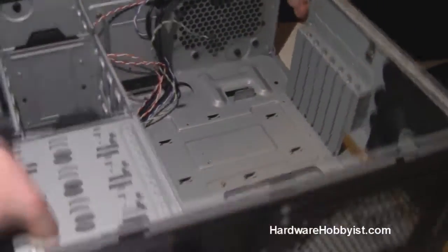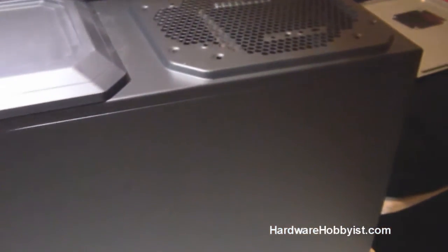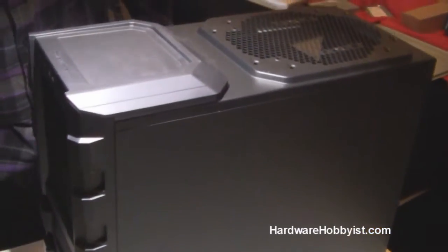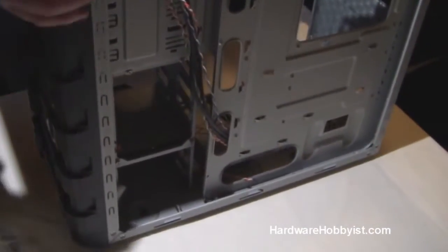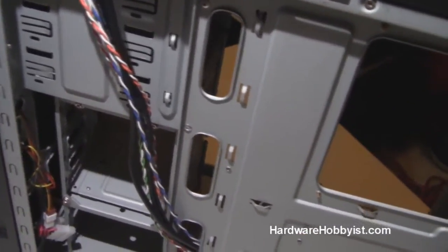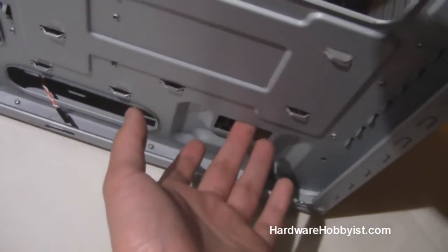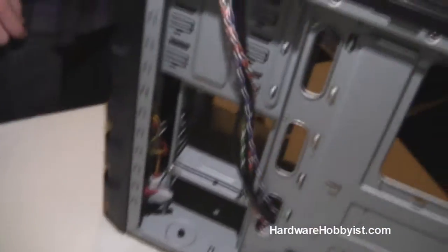So I'm just going to stick that to the side here and grab my screwdriver. While Max is doing that, I want to talk about the importance of managing your case, especially your power supply cables. The power supply we're using is non-modular, meaning that none of the extension cables that come out from it can be detached and reattached. So what that gives us is a bunch of useless cables. Case manufacturers have realized this and they provide ways for whoever's building the computer to hide the cables — stuff such as openings on the side to put cables through and hide behind the back of the motherboard case. The majority of mid to high end cases should have some cable management features, while lower end cases you kind of just have to deal with what you have.